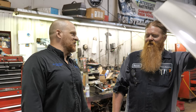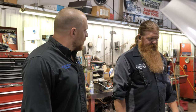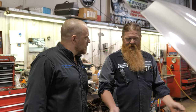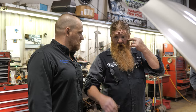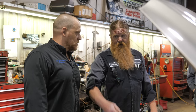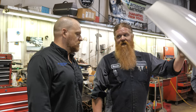We had good direction. Let's just see if I can pick this misfire up, and then maybe we'll drive it one more time and see if we can make it do it. Yeah, give it back to him and let him try it again. Because when I unplugged the front O2 sensor, it stayed at the 1.9. Which it would. And the rear one kept dropping and dropping, and then it went all the way down to 0.03, which is probably your lean issue. But you said unplugged upstream. Unplugged up, and then it quit stalling after that because it stayed in open loop.